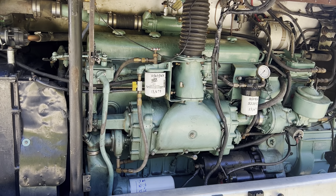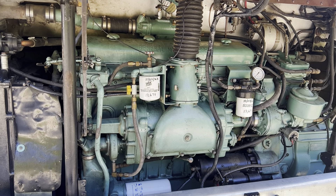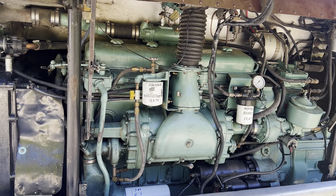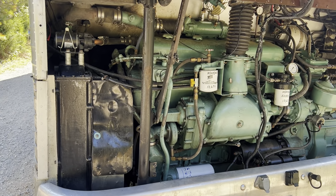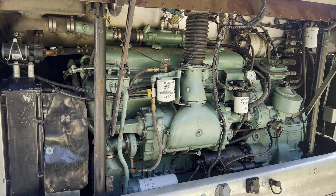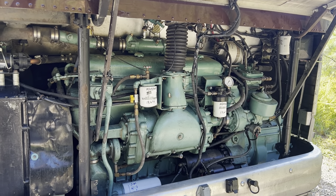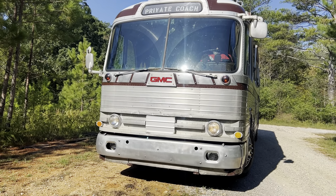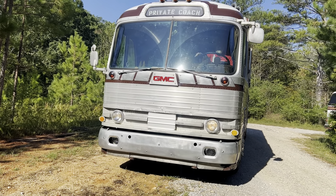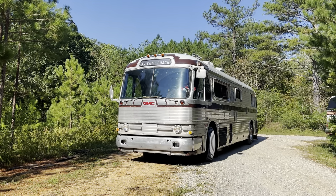Looks pretty good in there — it's right full at the top. Still a little bit of that oil-water at the top but not a lot. We took the gasket off the radiator cap so that it doesn't seal, so he's not building coolant pressure on the way home. It only runs about 6 psi in that system anyway. We're going to not let it build up pressure so it might blow out a little water since we have it all the way full right now. He'll continue to clean out the cooling system, but the engine oil looks great. We gave him a procedure of checking his oil with the engine hot, two minutes after shutdown. Right now it's about two-thirds between full and low — super clean oil, no sign of that grayness. We're not leaking any water — it sat all night long and no water came through. I think we dodged a bullet and got lucky on this one.